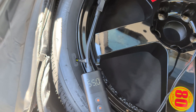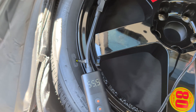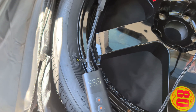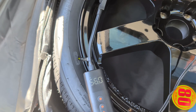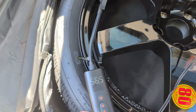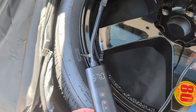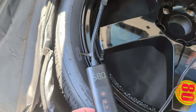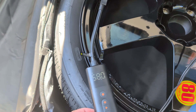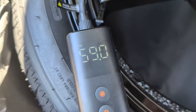Same with my normal four wheels, which are on the car all the time — I check the tire pressure once a month or so, because that's what's recommended by NRMA and my local Bridgestone tire shop. It's always lost a few psi along the way, and you're going to adjust it for weather as well, because in winter your tires will be at a different psi than in summer. Summer will make them inflate to a slightly higher level.